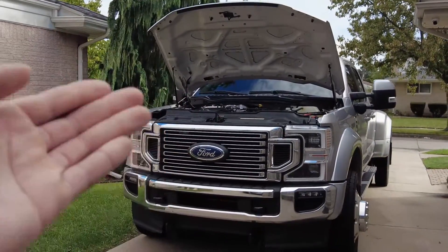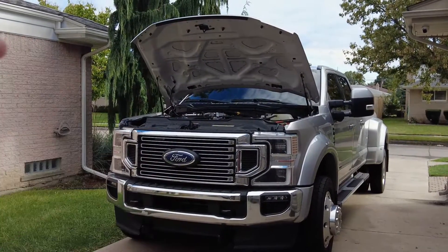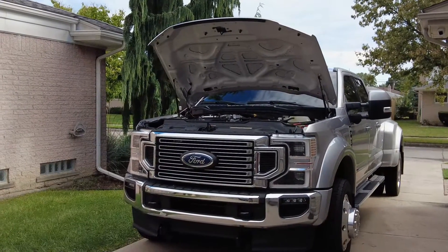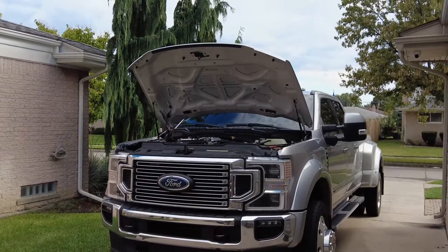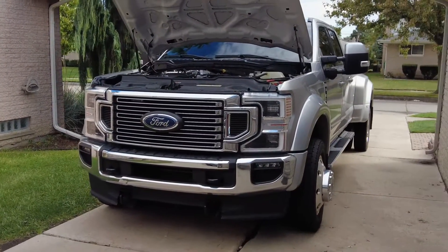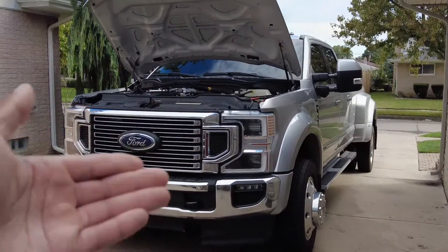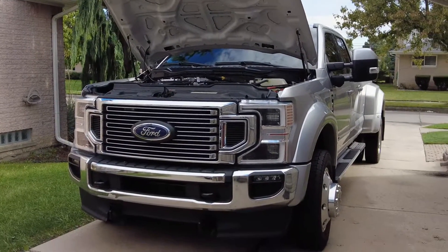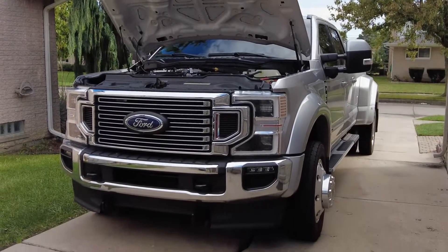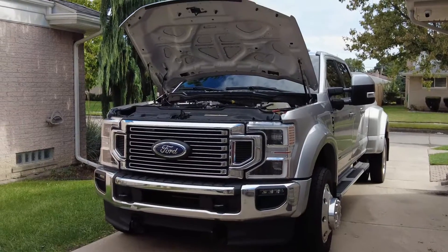If you're a guy who's not driving it enough and the fuel sits in it for three months and you don't empty out the fuel, guys that have these sit for a while — it might be more important for you to check your water separator because diesel fuel is hygroscopic, meaning that if you're not cycling your tank, the diesel fuel itself can absorb water. And sometimes you can get contaminated diesel just from a fuel station.